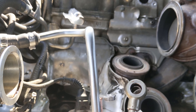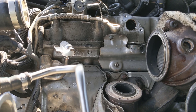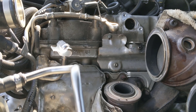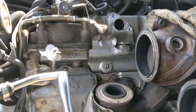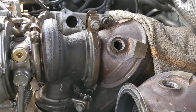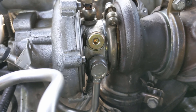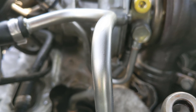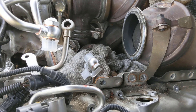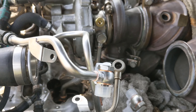Leave everything loose, just setting in place, and then we're going to reinstall the turbos in reverse order. We're going to start with the one on the right side of the car — left when facing it — because that should be easier. The first turbo is in with all lines started but not yet tightened. Next we'll drop the second turbo in, hook up our lines, and see what we have left.